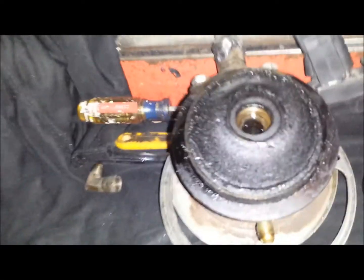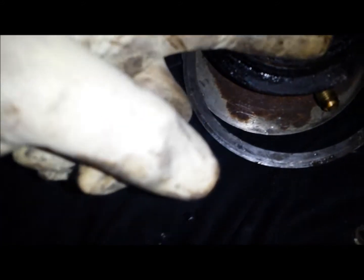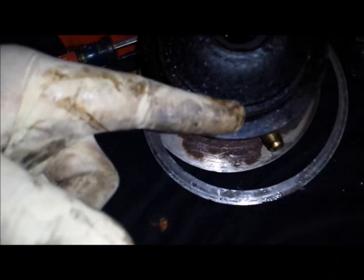From inspection you can see all that Rotella 15W-40 getting burnt and caked up on the back end. There's your center section — bearings are inside. It's this retaining clip in the back that usually collapses, and that's where a lot of this oil seeps through. Also if your crankcase isn't pulling enough vacuum that's a factor. Oil seeps out here, flows down, and comes out near the T3 flange close to the exhaust heat — god forbid this catches on fire over a stupid oil seal.